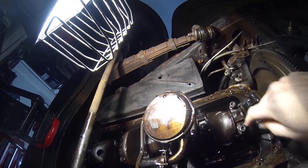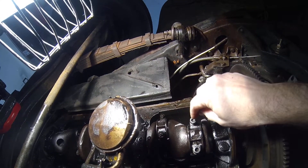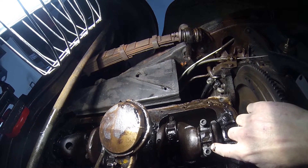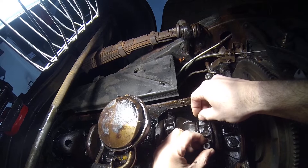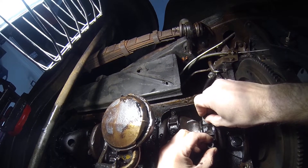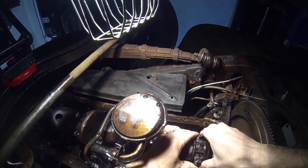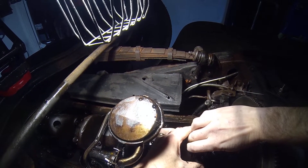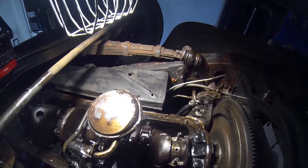This is the rod bearing — the connecting rod. This is a major intervention into the engine, so it's important to pay a lot of attention. We put the parts back exactly as we found them. I've already noted where the markings are on this cap — it goes back on the exact same way I'm taking it off. I took a three-eighths ratchet to these nuts and loosened them already. There are lock washers — make sure you collect them, don't lose them. I may have tapped it with a mallet to slide it off. Now we can see the surface of the crankshaft.